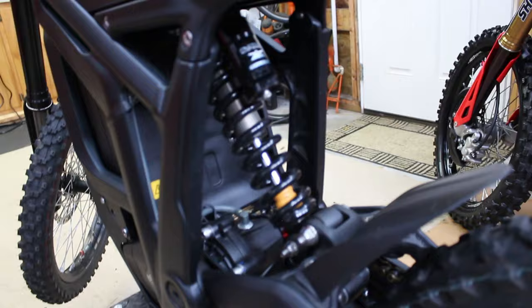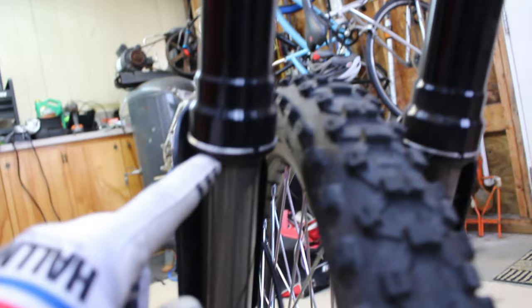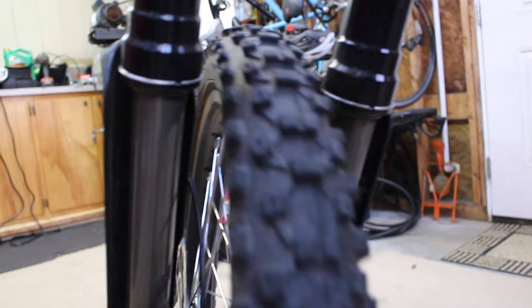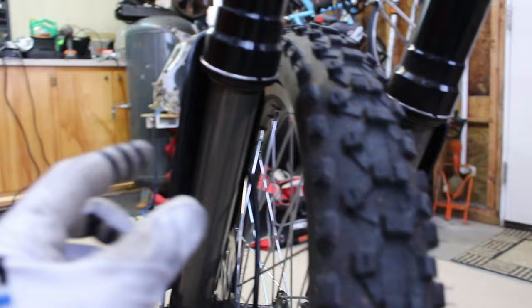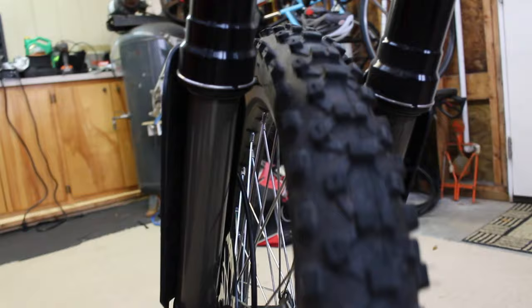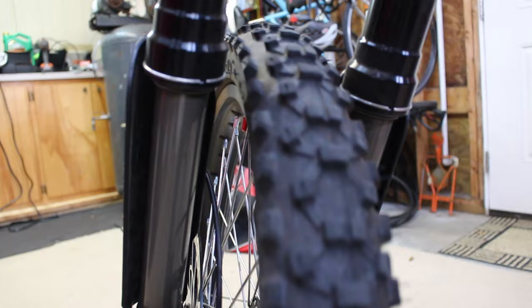As for suspension, I don't think the rear shock is going to require too much maintenance, and I'm fairly impressed with this new factory fork. Periodically check the fork legs and see if you're getting any leaking from the seals — if so, you probably have dirt that's gotten up there and damaged or gotten stuck in the seal. An old trick my dad and I used in motocross racing was to take a thin piece of film — like an old film negative — and shove it up in there and move it around. Sometimes if you're lucky, it can dislodge whatever's stuck in the seal causing oil to leak out, buying you time before a full rebuild.